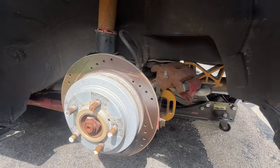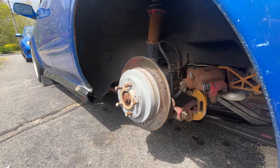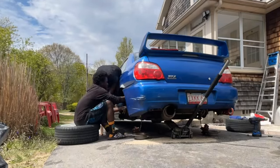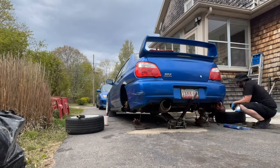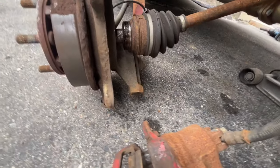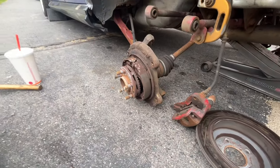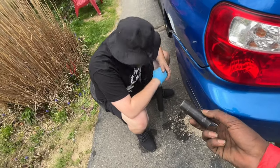I got the side off, got the caliper off, and now I'm gonna get this axle nut off, then take out this Jesus bolt, and slowly but surely get this knuckle out. I don't think it should be that hard. The only thing I'm really worried about is the e-brake. I've got the knuckle pretty much almost disconnected — I just forgot the 17mm bolt back there on both sides. Then I'm going to disconnect the brake cable and the wheel speed sensor, hopefully without a problem.